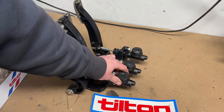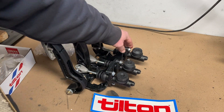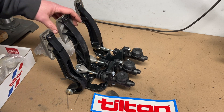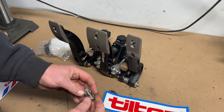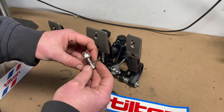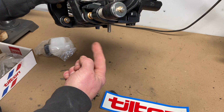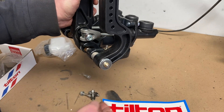Standard master cylinder sizes are $70 to $80 each for a name-brand one. These are $100 each, but in the end that's only $50 more, and I don't like to cheap out on safety. Now, mounting them — they've made it super easy. There are just four mounting locations and I believe these are M8. What I do is get a wavy washer and a serrated nut, drop it through to your mounting plate, and when you start to tighten that nut, it'll grab the bolt. You can have a nice tight pedal but be able to loosen it for adjustability, as you've seen in the other videos.